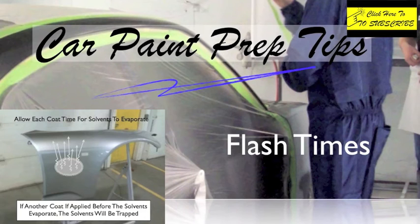If it says 5 minutes, allow it to flash for 5 minutes. And another thing to consider, if it says allow to flash for 5 minutes, whenever they did that study, most of them use around 70-degree weather. Well, if you're in a shop that's 60 degrees, you may allow it to dry a little bit longer. If it's 100 degrees, it may not take quite as long. So something to think about, and be sure and look at your P pages to determine what that time is, the flash time.